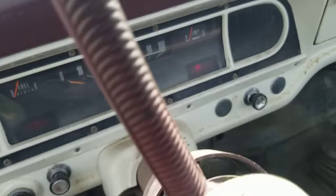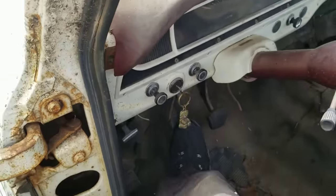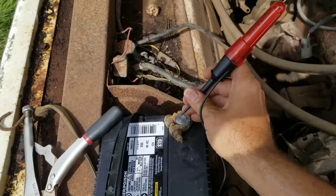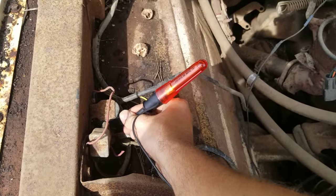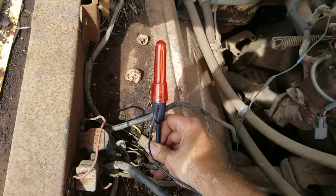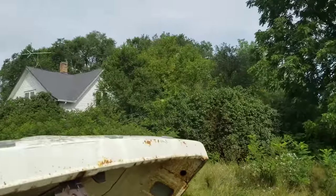Nothing. Do we got a light up there? Zero crankage. Great. That's perfect. All right. Relay jumper 200. Nothing. Let's see. Got juice here. Yep. Got some juice down here. Yep. No juice there. Okay, Bradley, turn the key to start. Off. Start. Okay. Right out of the gate. Bad relay. Great. So those are gonna be really easy to find.